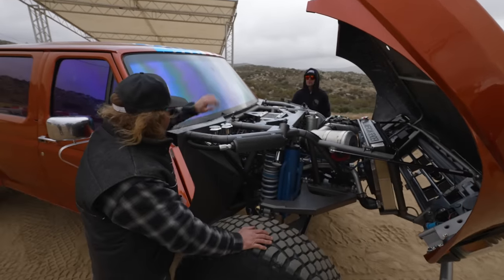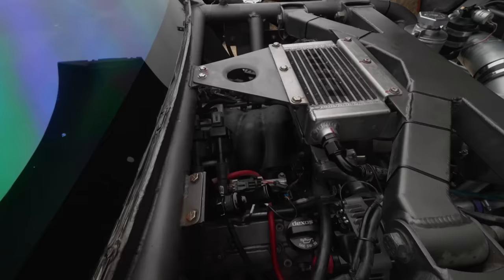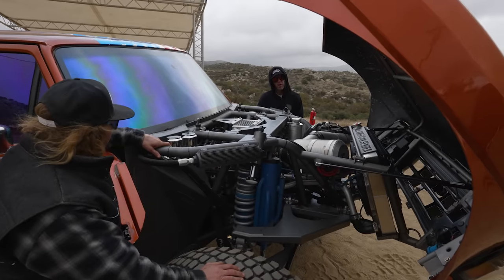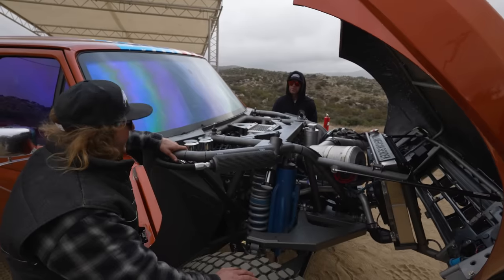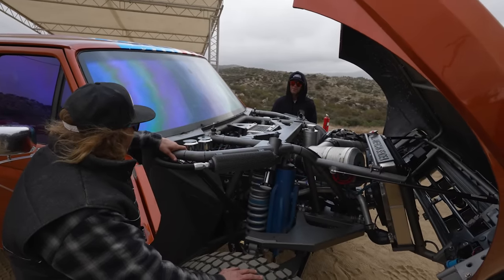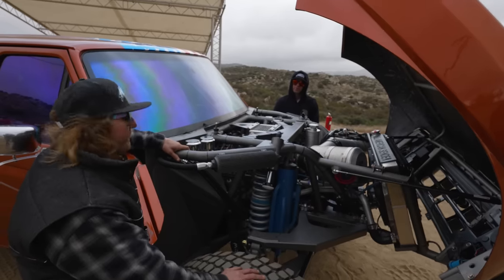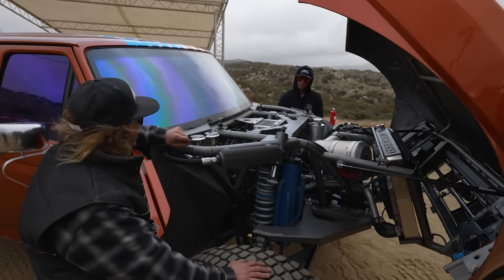Cold air over there. What's the platform of this engine? What kind of horsepower, torque? What are we working with? This is an LS3 525. You'll find those in a 6100 trophy truck. I think they put an aftermarket cam in there, so 560 to the crank-ish. Have we dynoed it to the tire? What are we making through these 40-inch tires? To the 40-inch tire, it's 383. What's your final gearing? It's 5.43. Spicy. Three-speed transmission? Turbo 400 three-speed with the manual valve body. She bangs!